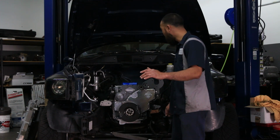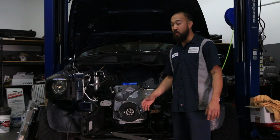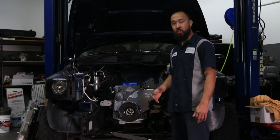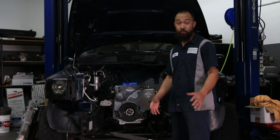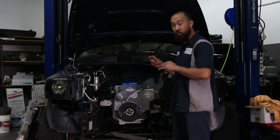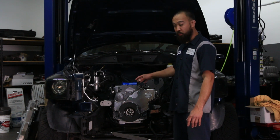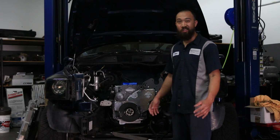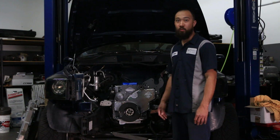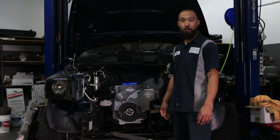I went with the main studs, or main bolts, which a lot of people have been wondering what's going on with. Chase has actually been testing 9/16 main bolts with a stock girdle, just utilizing the factory girdle. You cut down the main caps a little bit so the heads of the new bolts will fit. But basically, I went a little different route than most people do. I didn't do a Gorilla girdle. I didn't do any of that. I went with 9/16 main bolts, drilled and tapped the block. These gnarly bolts go to like 180 foot-pounds. I mean, they're beef. If anyone has any questions or wonders what's going to happen, we'll just wait and see. I have no problem spinning this thing to 5K, so yeah, proof is in the pudding.